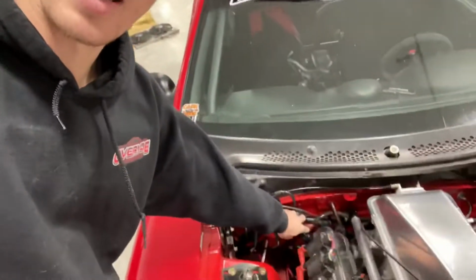And then one other thing I would say to anyone else doing any of this, don't put your breathers on the back of the valve covers if they're not baffled. These ones are not baffled, so they typically catch a little bit of oil going through them, because when you launch the car, everything pushes back to the back of the valve cover, and then there's nothing covering up that fitting. It makes it very easy for them to fill up with straight up oil. So that bothers me quite a bit, but there's not really much I can do about it.